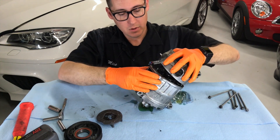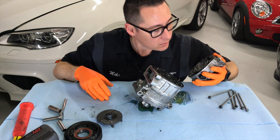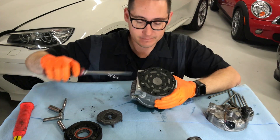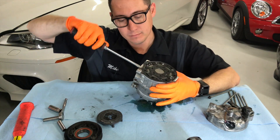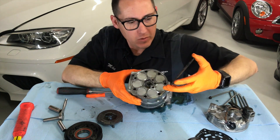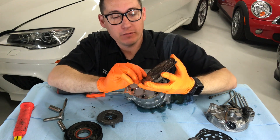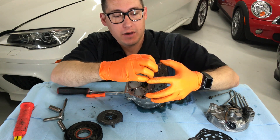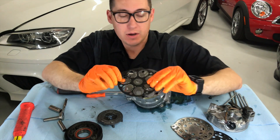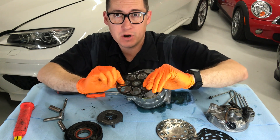More oil. This is the cylinder head, gasket, and reeds. These reeds act like a check valve. What they do is go over these little passages here and they can open and close based off of pressure.